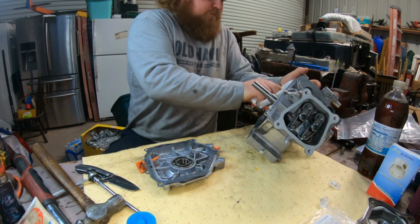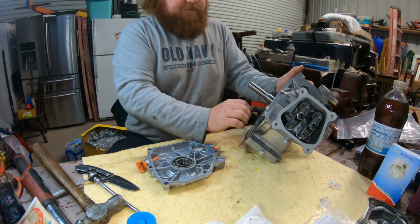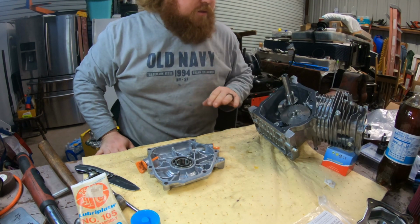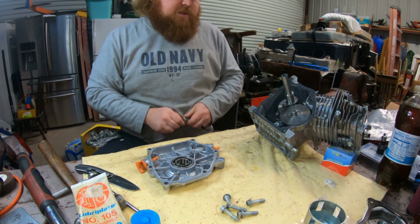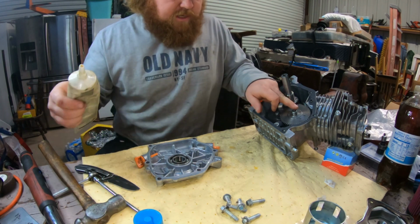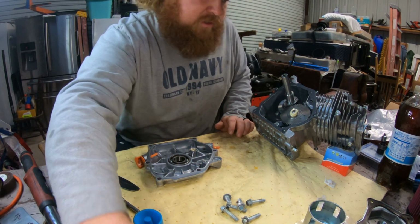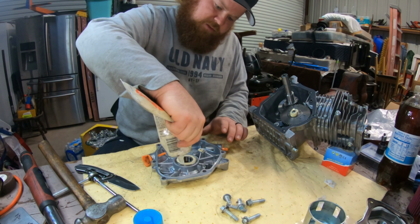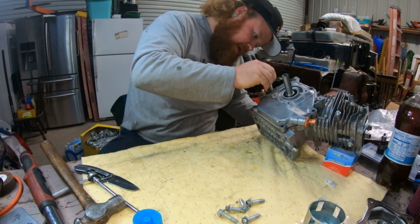And a quick wipe. This was already cleaned off. I did that already. Like this. Line it up. Okay, get the gasket on there. If you remember, keep all your parts together. You have your parts still. Put a little dab of assembly lube. Guess it's not a little dab, but fill it. And then also I put it inside the case. Nice. Fill the bearing as well. Slide your cover back on.